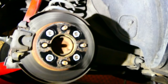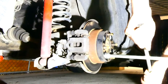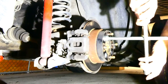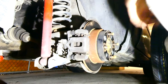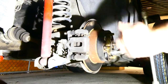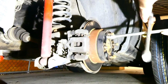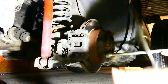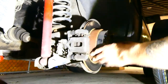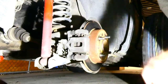Before putting on the wheels I decided to take off the spacers. There are 20mm spacers all around — as you can see they're pretty chunky. They've gotten loose at some points, so when the bolts inside get loose they start clunking around like a broken wheel bearing. I only tightened the front ones, but when I came back and undid the rear left — the passenger side — they were really over-tightened. Someone had had that issue and tried to bolt it down really tight. I don't really like spacers. You could solve the spacing issue with the right offset wheel, which will give you more dish anyway.